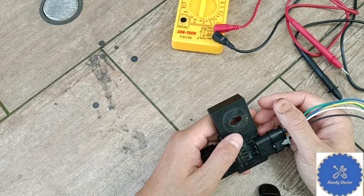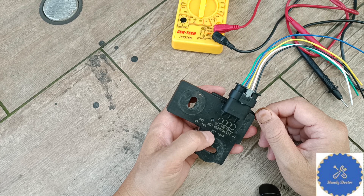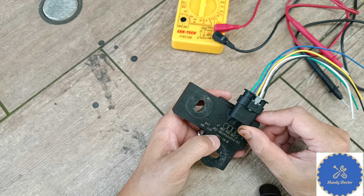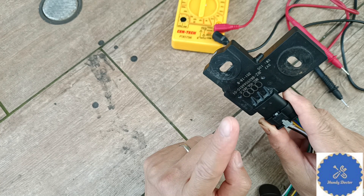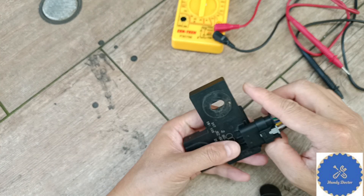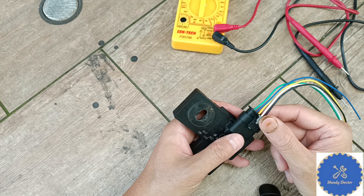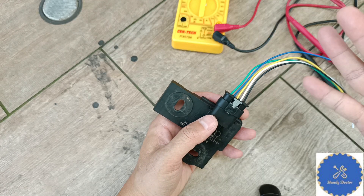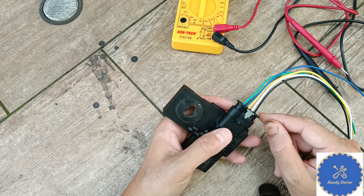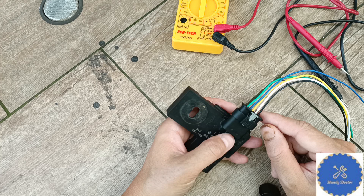The code is about the EVAP system. Specifically, it is the temperature sensor — this is the so-called temperature sensor module. P2024 is circuit disconnected, meaning somewhere the wires don't touch each other. P2025 is low performance, and P2026 is low voltage.